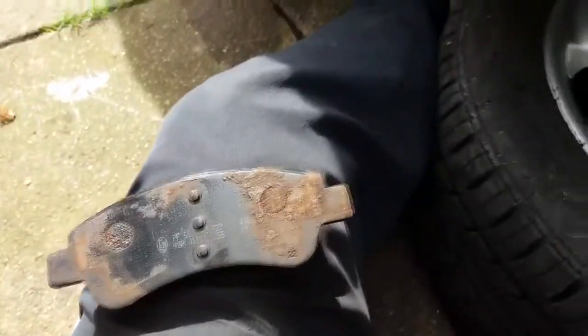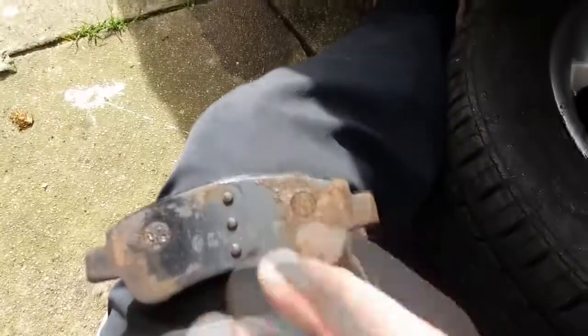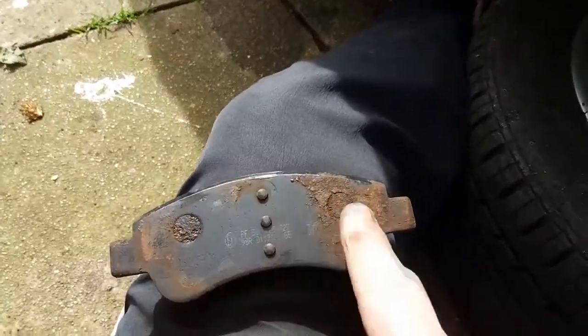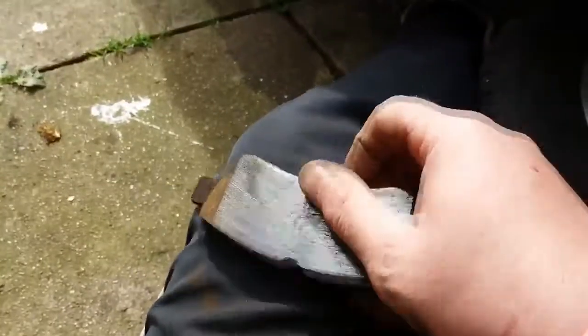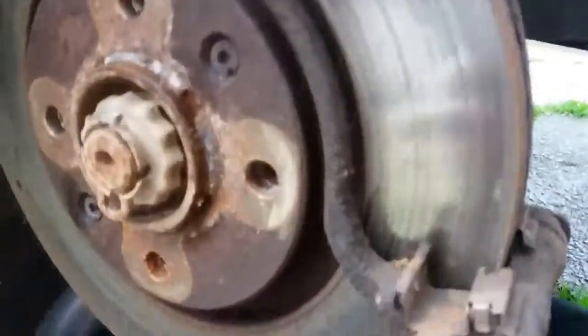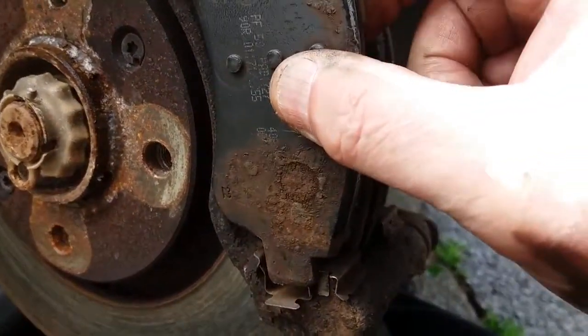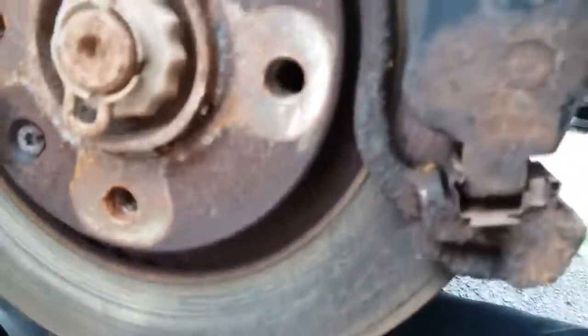When you get your new brake pads, people ask do you use copper grease or not? Personally, I do. Get a bit on your finger and rub it on the metal surface at the back of the brake pad - like that. Don't put it on the friction part, because you won't have any brakes - you'd be taking away the friction. Just smear it on the back there, not loads, just enough to give it a little covering. When you're putting your brake pads back, make sure you put them back the right way around - I've seen many people put it metal to metal. Make sure you put the friction part facing the disc.